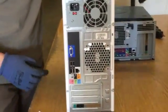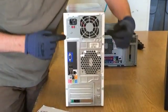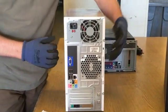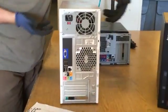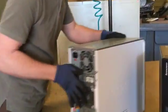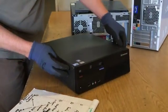Next option. So that was opening on one side. This opens on two sides. We know that because there are no rivets here, but there are screws. There are screws in there, they can come back out. Screws on both sides. That's important because if there are screws on both sides, they're giving you access to both sides, so both of these walls are going to come off because you'll need access screws on both sides, usually to remove the hard drive or the media drive. And then the last kind opens up like an alligator mouth.